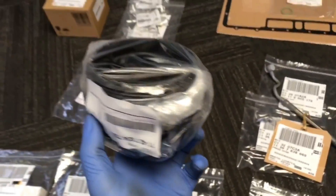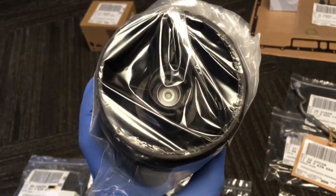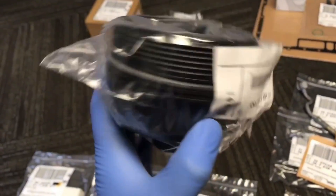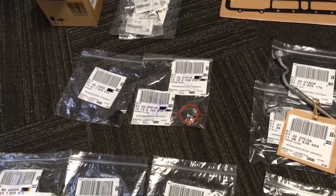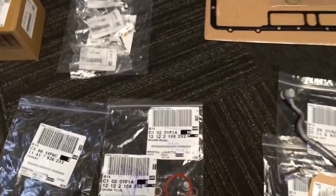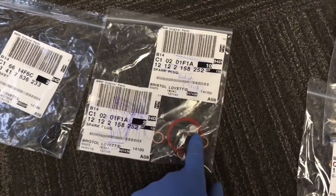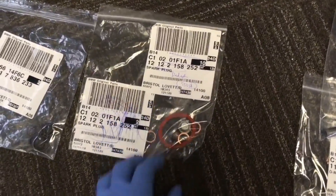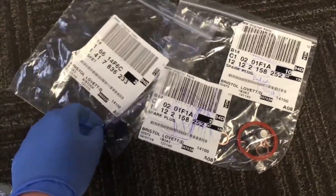There's also the option to change, for relatively small money, the oil filter housing. On the V10 it sits upside down, so whenever you get any bearing material or debris it always collects in the bottom. For about another £35 it's always good to change that to save any particles being stuck in that system. This customer has also specified a dual drain sump - the front sump bolt is an addition because it's currently only got the single one. We'll need both oil drain plugs, the oil level sensor O-ring, copper washers, and also the side O-rings for the oil pumps on the side of the sump.